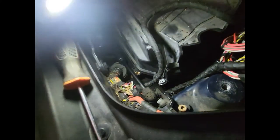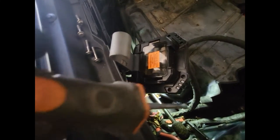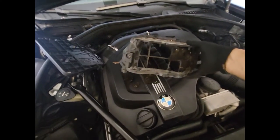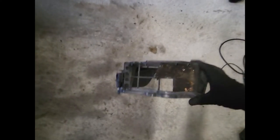The recirculating air sensor has to be unplugged. You can get away with pulling the cover first and then unplugging it — the plug has a push tab but it's on the side, not the front. With my right hand I pushed the tab and with my left I tugged on the edge of the connector with a screwdriver and it slid right out. The sensor just has two tabs on the back — push them and it comes out, then relocate it to the new cover.